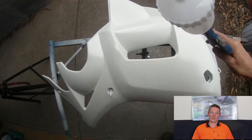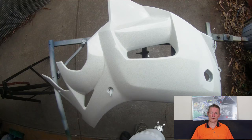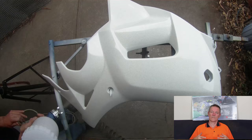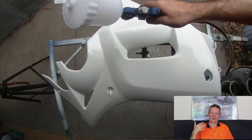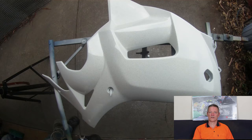It's not rocket science, you just have to be careful. Okay so here we go, this is clear coat going on now. Same process would have happened — it would have dried, I would have cleaned it with grease and wax remover. Same process over and over again every time you paint from one type of paint to another: from undercoat to colour to clear, clean it in between, make sure that it is spotlessly clean. This had three coats of clear and this I believe is the last coat going on right now.